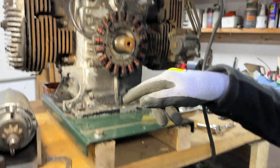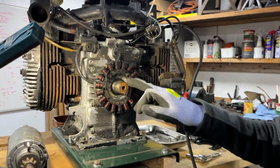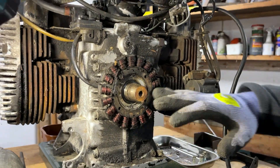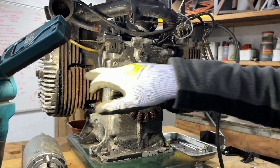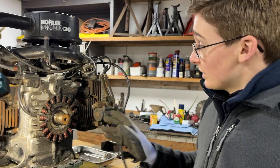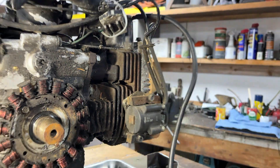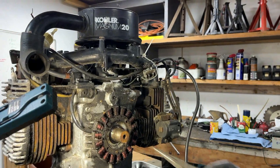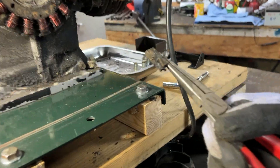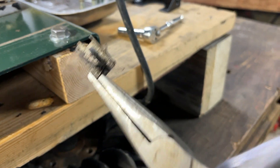You may have noticed we've taken the flywheel off to get more access to the front of the engine so we could make up our bracket. We did notice a couple of things while that was off — you can see this kind of fresh rust on the end of here, which is really not good because that suggests the water level was up to about here, which is about piston level where the heads are. Something else we noticed is there seems to be some little clip thing wedged between the cylinder fins, which I assume dropped down from the top of the engine, hit the flywheel and went flying. I'll just try and pull that out now — there we go. I'm not fully sure where that's come off but I'm sure we'll find something that's missing a cover or a clip at some point.